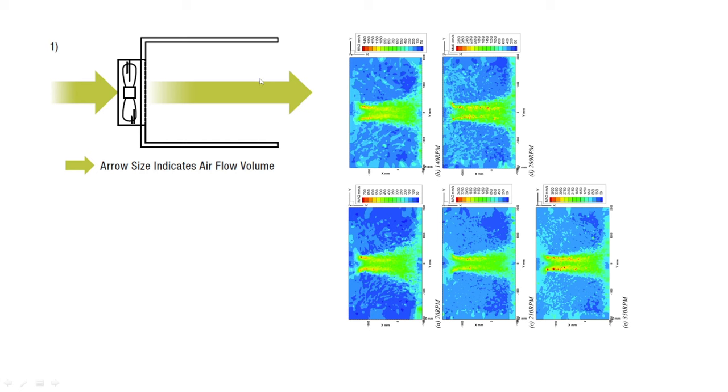And you would need a slit or a variable valve to get a bunch of different pressure readings in there, and you'd be able to know how good a fan is at a bunch of different pressure scenarios. So again, it's scientific. It gathers data. It gives you a lot of really useful information for how good a fan is at different types of heat sinks, but not in a case airflow environment, so open air environment. It tells you nothing about that piece of information.